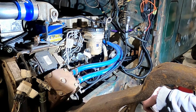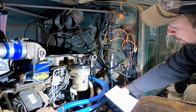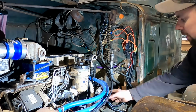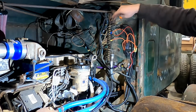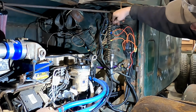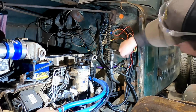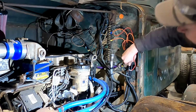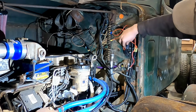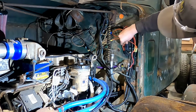This I know is the battery. So what I want to check here is basically that we have the always powered and the switched and the ground connections properly hooked up to this round connector from the bus. I know that this top one is just straight battery power with a nice big, I don't know what that is, probably 6 gauge, 4 gauge wire. Oh, 2 gauge. Yeah, nice heavy wire coming up there. And none of these are hooked to that. Even though these are fuses in here, so this is giving fused power to the ECM if it was moved up there.